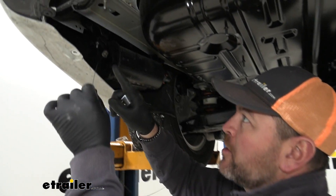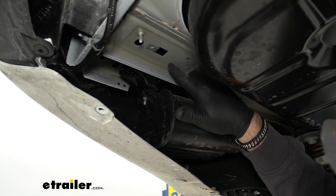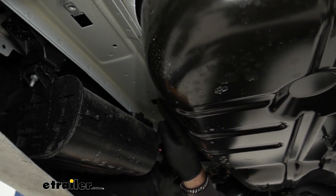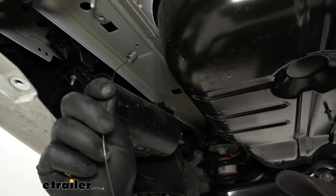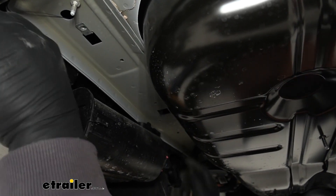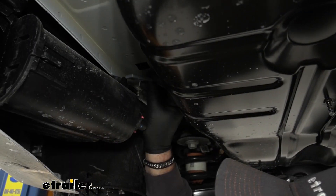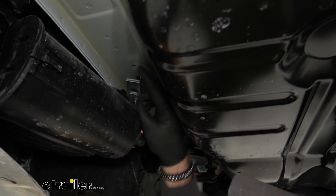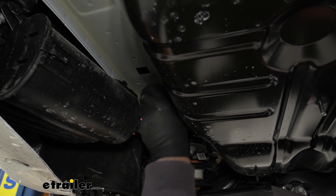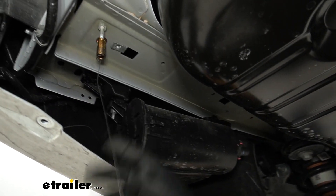On the driver's side, we're going to take our pull wire and go through this very back hole. We want to push it over along the outside edge — there's actually a wall that goes in right here, making it hard to get hardware through there. We want to feed this through and come out of this hole. Once you've got it through, make sure it's on the outside of that wall. Feed the spacer block on, push it up inside the hole, take a carriage bolt, thread it onto the end of the spring, and feed our bolt inside — then pull it down.